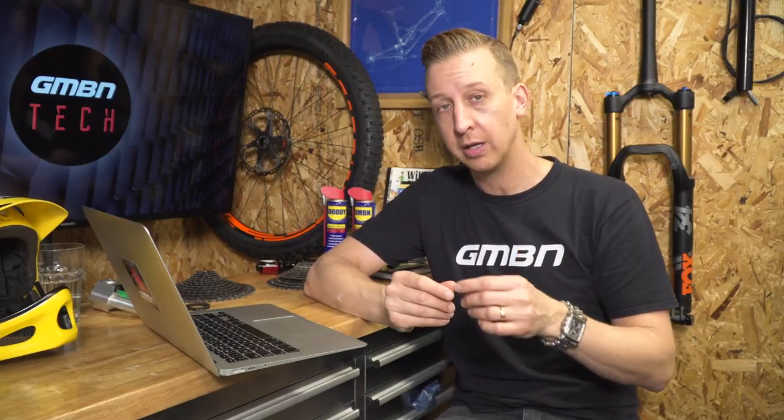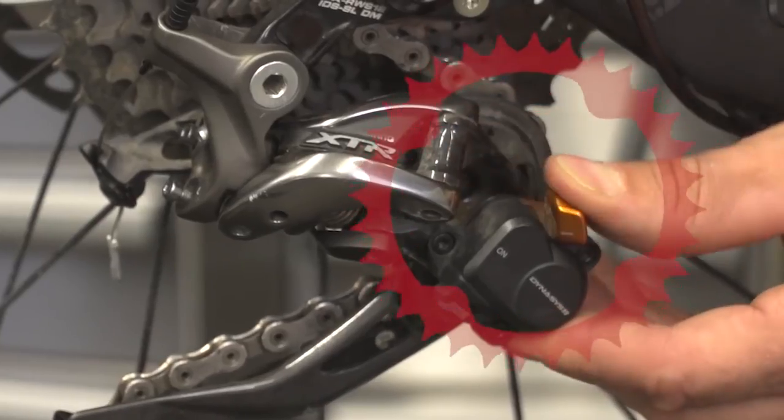Service intervals depend on how often you ride, where you ride, the conditions, and how aggressively you ride — so monitor your shock and make sure it's generally in good condition. Every 100 hours, RockShox recommends a full damper service: taking it apart, inspecting it, replacing o-ring seals. Before diving into the shock, take the shock off the bike and cycle the rear end up and down to check for play or movement on the rear pivots. Something could be loose or worn. Then put the shock back on and take the chain off, or if you've got a Shimano mech, turn the clutch off. Cycle the mech through, because the clutches on rear mechs can have quite an effect on suspension travel — almost acting like a low-speed compression damper on a minor scale — and you can feel that through the pedals and sometimes the shock.